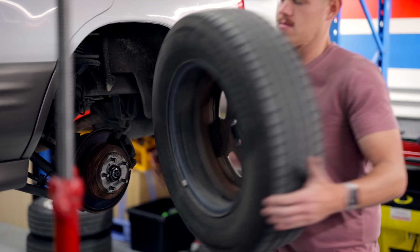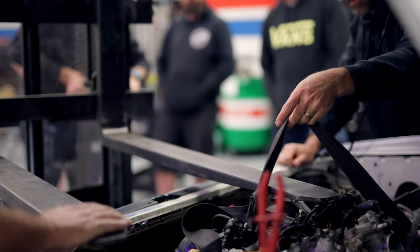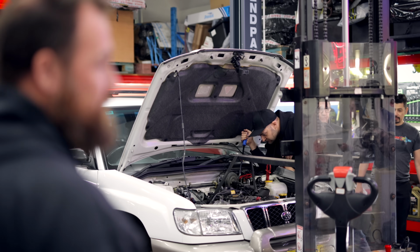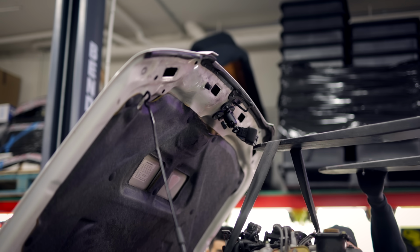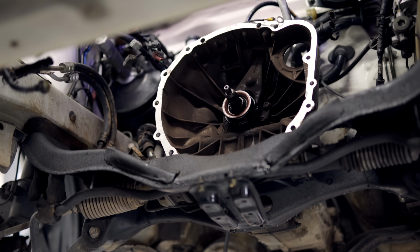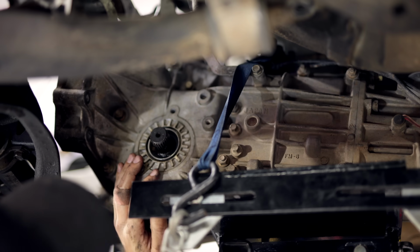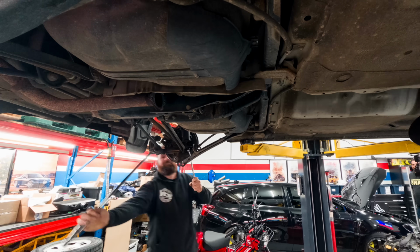We're going to be using as much of the Forester driveline and electrical parts as we possibly can, so we'll be stripping this Forester right back down to basics. We've chosen a 2-litre EJ20 out of this specific Forester as they have a good balance of weight, power and willingness to rev, which in a Brumby will be great fun. You also don't need to cut up your classic car to make it fit, and importantly, it's possible to engineer the modified car in our state for road use.